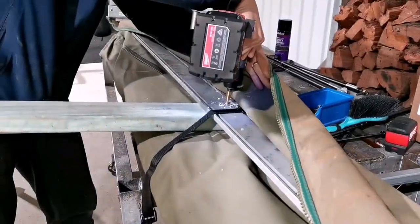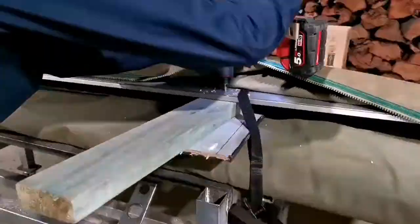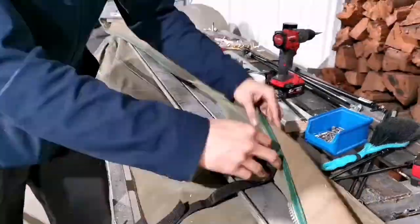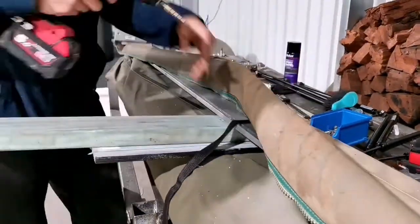By using a 12mm high tensile bolt, yes, that would mean I have to drill some 12mm holes in the awning, but it is okay because the awning has a really big aluminium mass. That M12 bolt is only a very small proportion of it, so it actually adds a lot of strength to the awning itself.